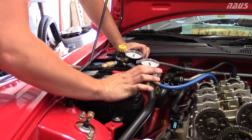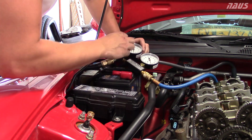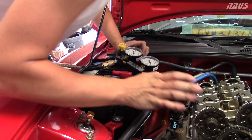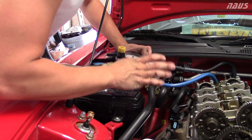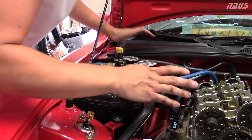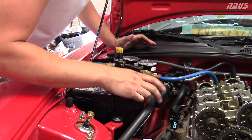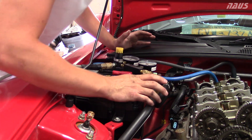The engine is cold, so when the engine is warm you'll have less leak down because the rings and cylinder walls will be warmed up. You can also listen for where the air is escaping — you're always going to have some leak down. Nine times out of ten with your S2000 it'll be leaking through the rings, which is okay, because all engines leak through the rings.